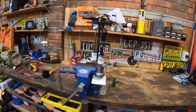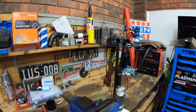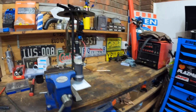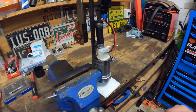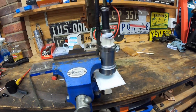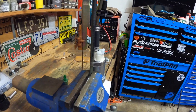Alright boys, there she is — 460 pump, couple of bulkhead fittings. I'm just going to go ahead and call that dash 8 return; it's just a smidge under it, but yeah, dash 8. Done. Oh, and that's submersible fuel line too, rated to 250 PSI, so it won't go all gooey. And E85 rated. I put a little kick just on that return there so the returning fuel doesn't shoot directly at the intake of the pump — there's a chance of cavitation on low fuel. So I thought if I just throw a little kick on it there, it'll stop that. Now that can go in the tank.